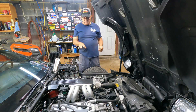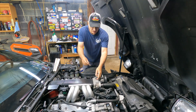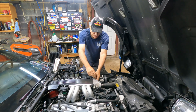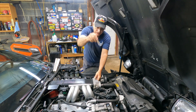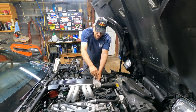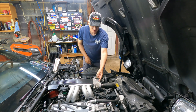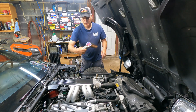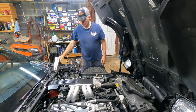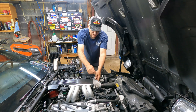Alright, I got the engine all warmed up. I'm going to start it and set the idle speed by taking a clothespin and sticking it between the stop screw on the throttle body linkage. That will hold it at the RPM I want. I'm going to monitor the RPM via a timing light and then spray water in it, and we'll see how that goes.